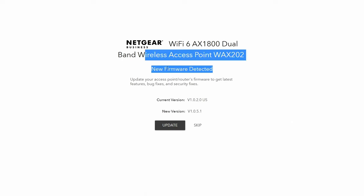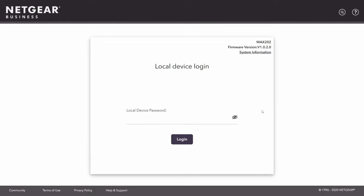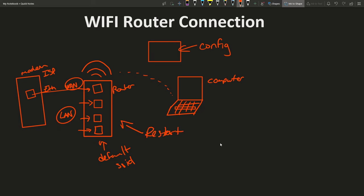After that, my configuration is complete and my router is checking for updates to ensure there's no new firmware — and there is new firmware. I highly suggest keeping your router upgraded to the latest firmware, as this helps protect against security vulnerabilities and is a fairly easy process on most routers. For now I'm going to skip this option because I want to show how to configure things manually. Now we're being asked for the router login password — user admin — and I'll put my password in and hit Login. You may want to restart the router once done with the setup wizard for configuration settings to take effect.